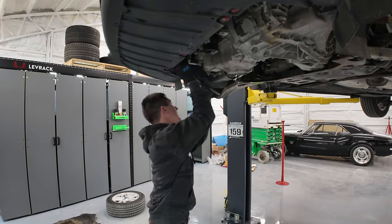I will say we also bought the toolkit just for this and I tried to put the plugs in the CV holes to keep all the fluid from leaking out because you're not supposed to have to drain it down if you have the correct tools. The dust covers, that's what they call them. They didn't fit at all. So we did end up losing half a quart of fluid. I don't know, maybe a cup. There's a spot this big on the ground. Nothing special there. But we lost a little bit of DCT fluid and we'll have to replace that.